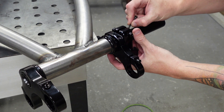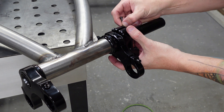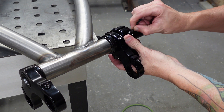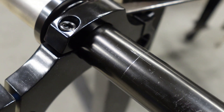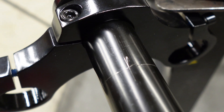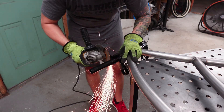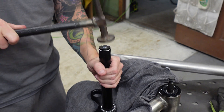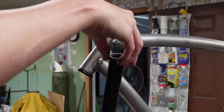Now we're going to throw on the gooseneck, and here is where we will take just anything sharp that you can to give yourself some scribe marks. You do not want to be on top of the gooseneck — you want to go down probably maybe a quarter of an inch to get where you need to be. You can see this scribe mark here, and what you want to do is cut underneath that scribe mark, because if you don't, when you go to put it all together it's going to catch itself and you're going to have play in the head tube.